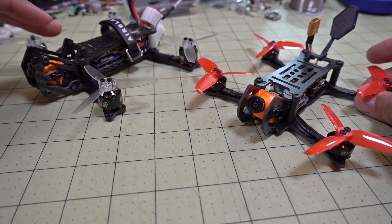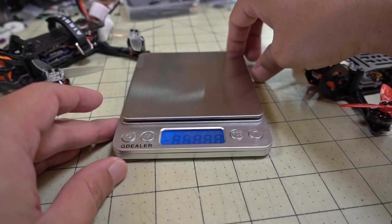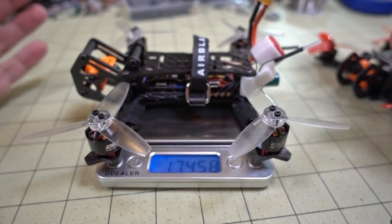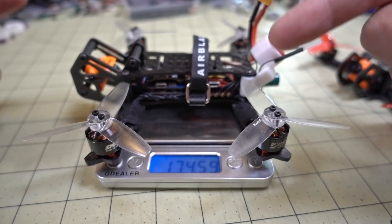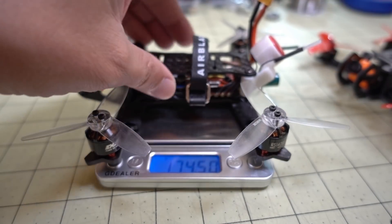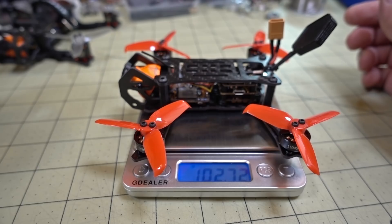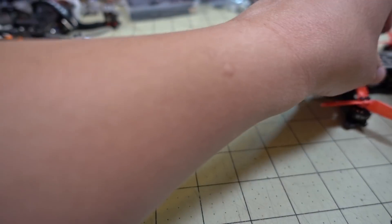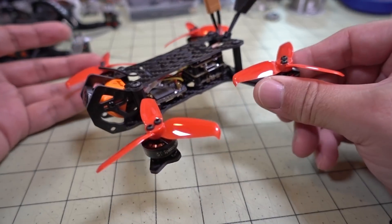You can actually carry a GoPro Session on here with this little camera mounting area. But the big difference is the weight. The 3-inch setup comes in at almost 175 grams without a battery, and when you go to the 2.5-inch setup it's a significant difference — we're down to 103 grams. So we're shaving about 45% off the total weight compared to the 3-inch. In terms of flight characteristics, if you want to fly this as a very small acro or freestyle flyer at the park, this lighter setup is going to be better.